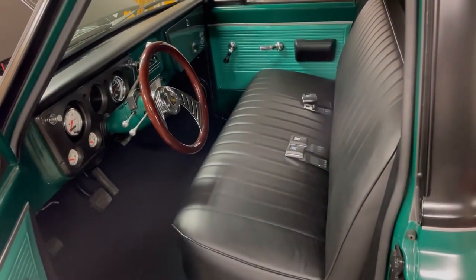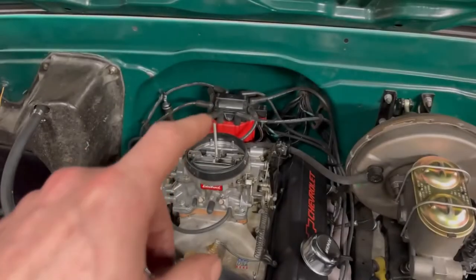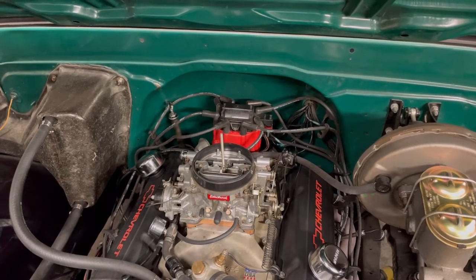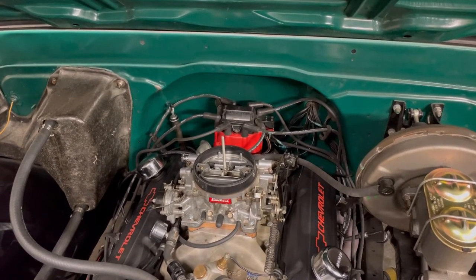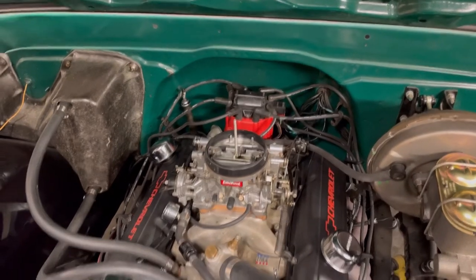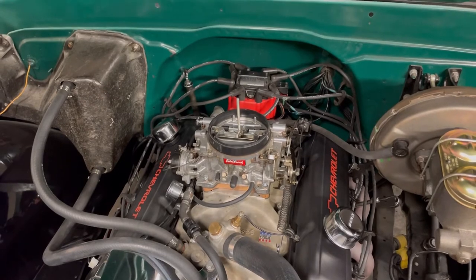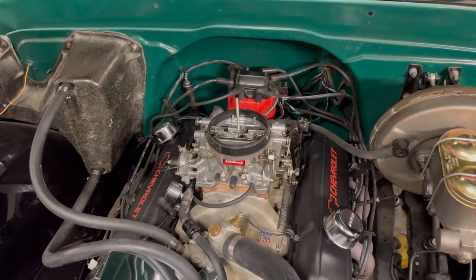We're gonna pull the truck up and wash it tomorrow — it's a little dusty from sitting all winter — and give the interior a detail while we're at it. I did just pull the distributor as well; the mechanical advance on there was a little gummy, so I took it apart, polished everything up, cleaned it up, and dropped it back in. I've also got to go tomorrow morning and pick up my PCV valve — believe it or not, the local parts house had to order in a PCV valve for a small block Chevy.